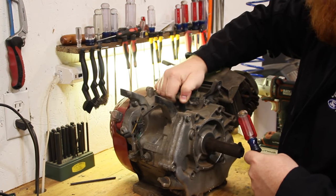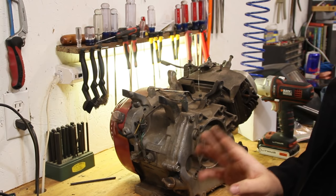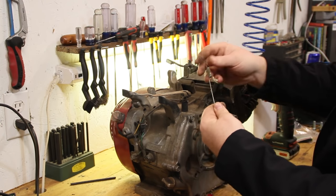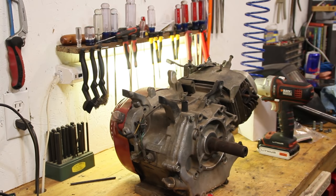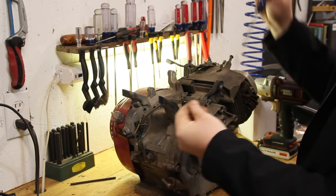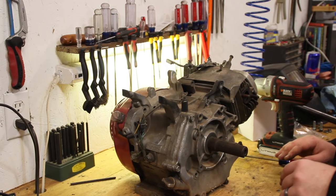Got that off there. If you wiggle it back and forth it'll come out. I removed that throttle rod because we'll probably reuse it later. Also going to keep this thicker spring that was on the rear of this governor arm because I use those as throttle return springs. Got that old arm off and this is garbage. I'm going to pull this clip out and keep it - these will come in handy on different brake and throttle setups later. Now I'm going to drain all the oil and remove this side cover to take the insides of the governor out.